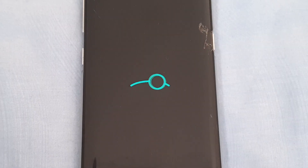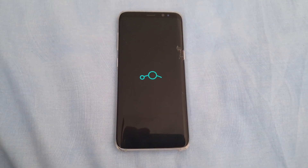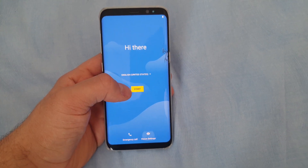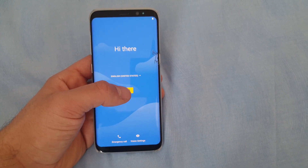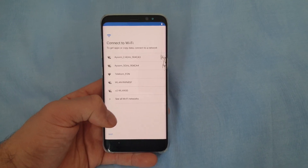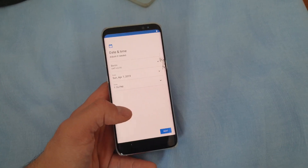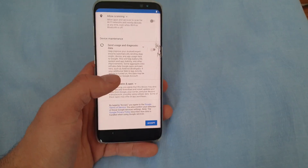The boot is finished now — the phone booted up, and this here is the welcome screen of Lineage OS. You will need to choose your language and then press Start. If you don't have any SIM installed, you can skip that and connect to your Wi-Fi network. Press Continue, press Next, untick all of these options, and press Accept.